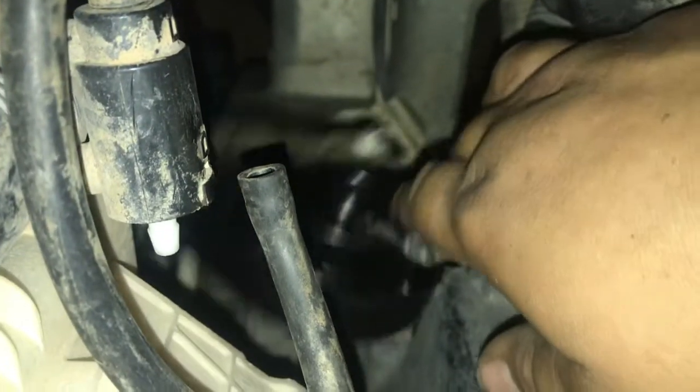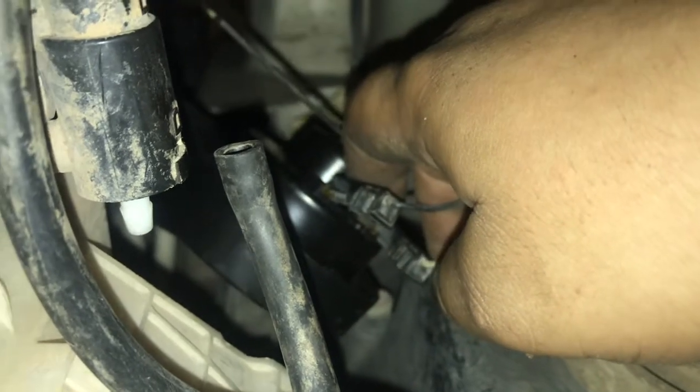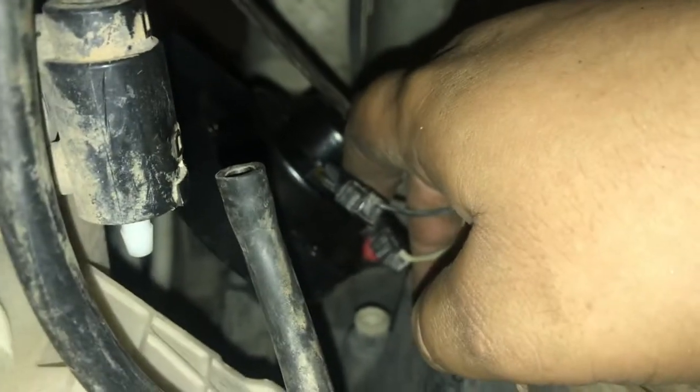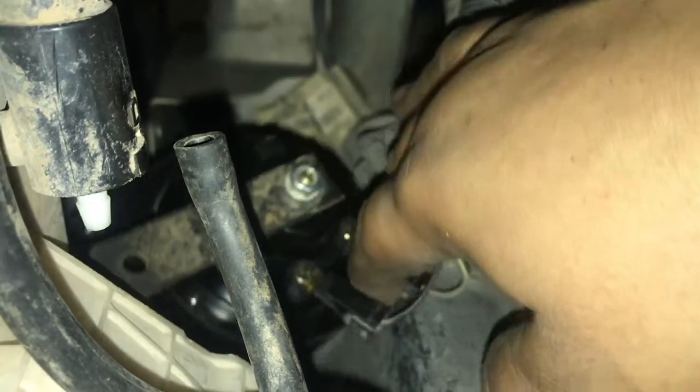And then this is the screw that comes out. And if you don't have one of these, you can always use Allen wrenches too. I used to use that, but now I'm fancy and I got the new Torx bit. But anyways, once you're done getting that off, and put this screw down, this is my new horn here. Already got it connected. Once you get that off, you're gonna pop these tabs right here off and take them off of your connections. And then to put the new one in, you just pop the new ones on. And yep, that's it for that.